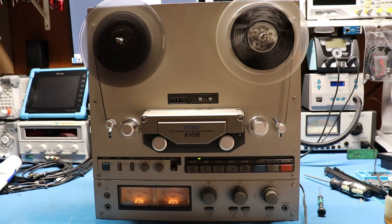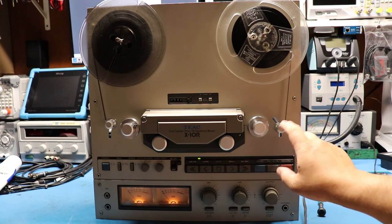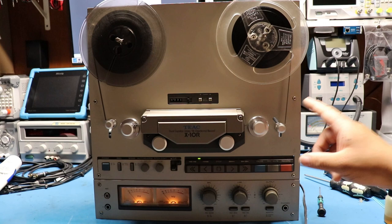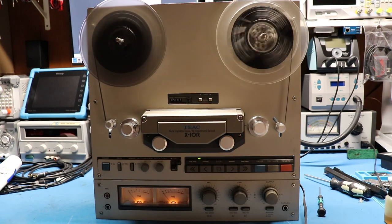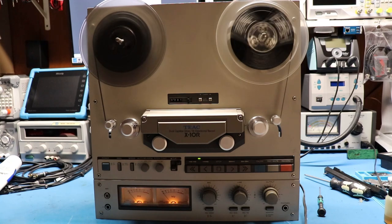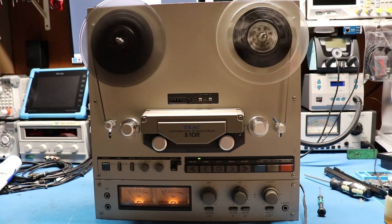During rewind the only thing you can hear is the tape moving past everything - no motor noise - because the motors are re-oiled. I've seen a lot of machines that whine really loud because people fail to oil everything. Also, people lose the washers on these for whatever reason - I have to point that out. Don't lose the washers; they are extremely hard to find and it always sucks when I go to take it apart and both washers are missing. Auto-stop and auto-reverse are also working - I put a piece of metal in there and it reversed on its own.